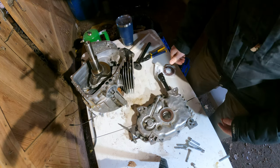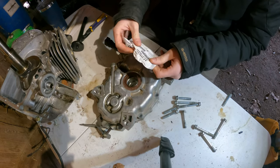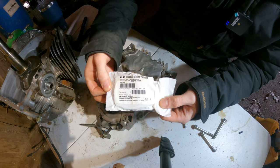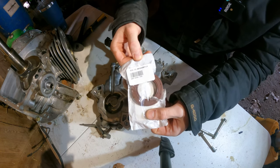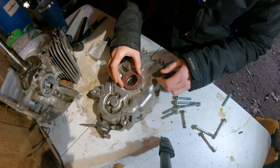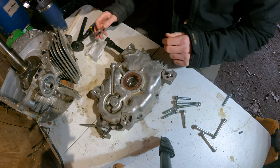The first thing I need to do before I do anything is make sure that the part I got is correct. This is a genuine Kawasaki part — I'll let you see the part numbers there. I want to make sure this is the right part before I take this one out. It looks correct; just want to make sure it's the right diameter, and it is. It has all the same markings on it as the seal here. So I'm pretty comfortable taking this out.